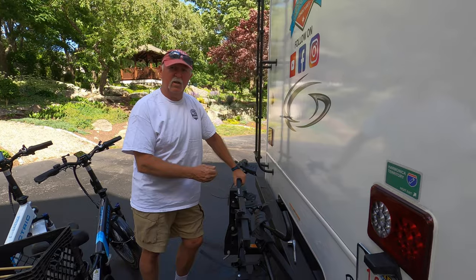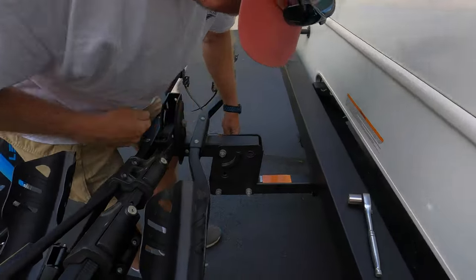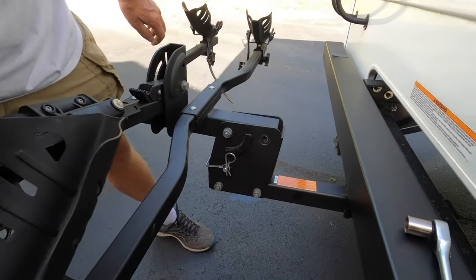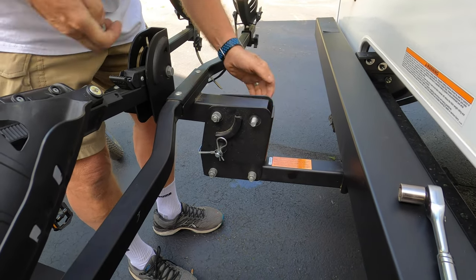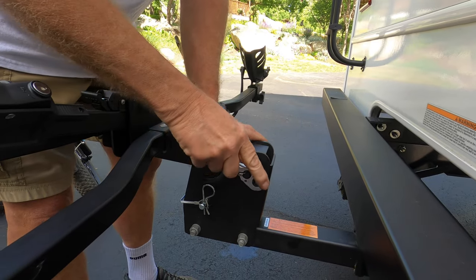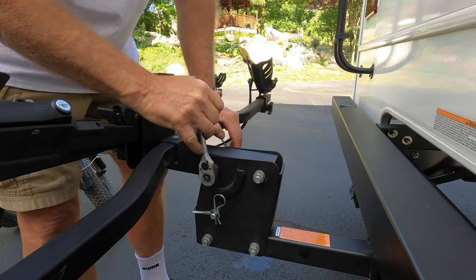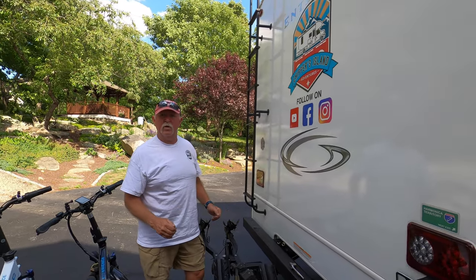If you have this on your RV hitch, it needs to be stabilized. What you do is take that pin and put it in the storage area right here, go ahead and lock that down. Then you take this bolt, put it through, and tighten it down. This way it is RV-rated. They want this to be locked down when you're riding down the road so it's not bouncing around. With that bolt on, it no longer can fold — it's locked down.